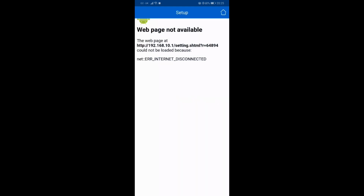The thing I did find though was I was constantly getting problems where on Wi-Fi certain devices would be saying that there was no internet, even though the Ethernet was working fine and the app itself was saying that I had internet. You would log on and the Wi-Fi strength would say that it was there fine, but there was no internet access, even though, as I say, there was on other devices connected to the same hub. So that was a bit of a pain. Had to reset it a few times, update the firmware, and then it seemed to sort itself out.